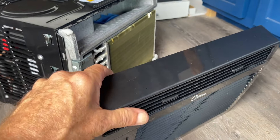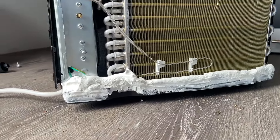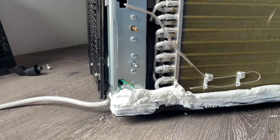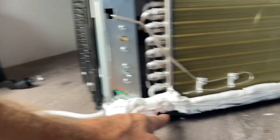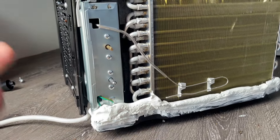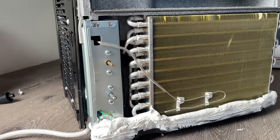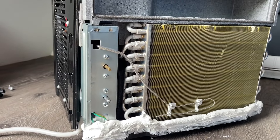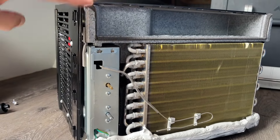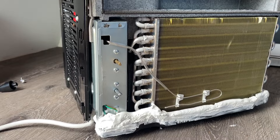The first thing I did was take the front cover off the air conditioner and build a condensation dam across the front. It just gives it an extra half inch or so — a little bit more maybe — to stop that condensation from spilling over the front edge of the tray. That tray will fill up with condensation when it's running properly, and the fan will splash that water around to keep everything wet inside, which is great. In a window environment, make sure it's not leaning forward — as long as the air conditioner is level or leaning back a little bit.